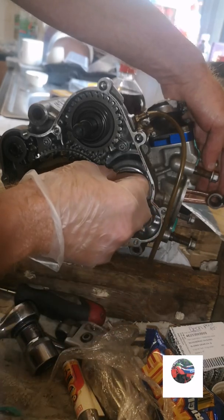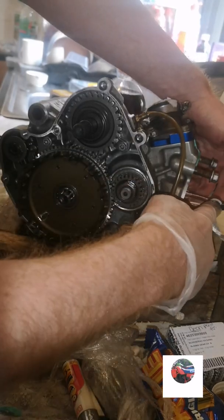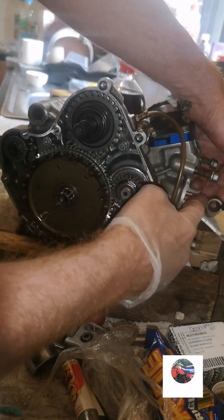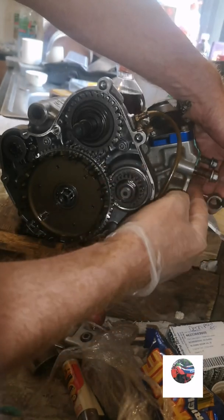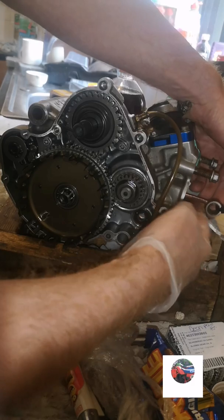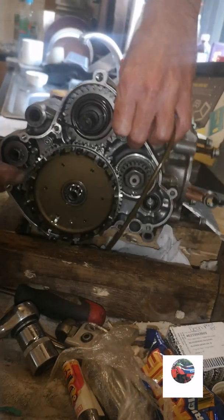There's a lot of penny in there to get this nut and the nut off the other side of the crank, because some people put stuff through there and these nuts are on tight. So when you're tightening that up and they're putting something through there onto here, when this nut's getting pulled back tight down, it's pulling down on your rod bearing, so you're putting tension on your rod bearing. So anyway, now that's tight, I'll go to this side now.